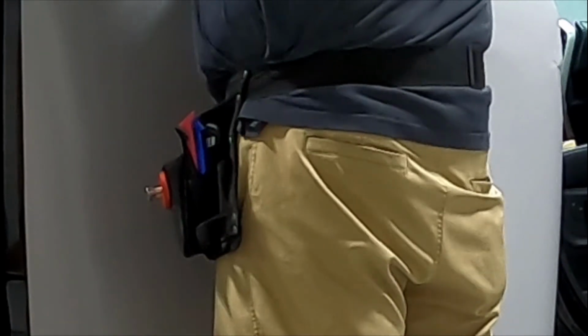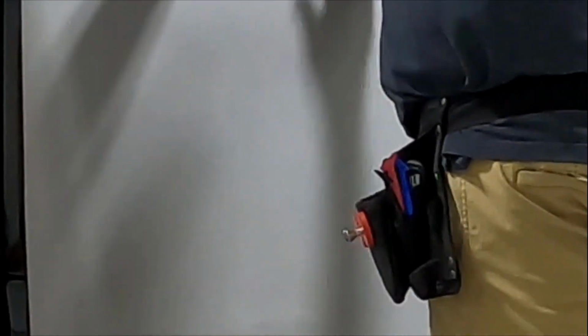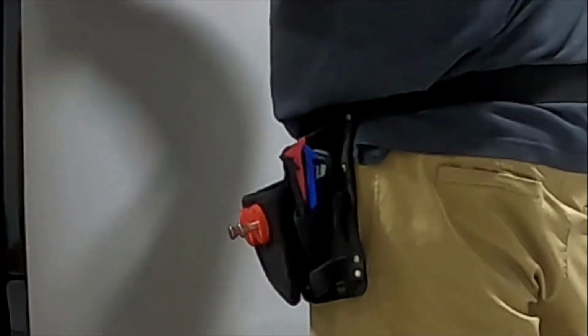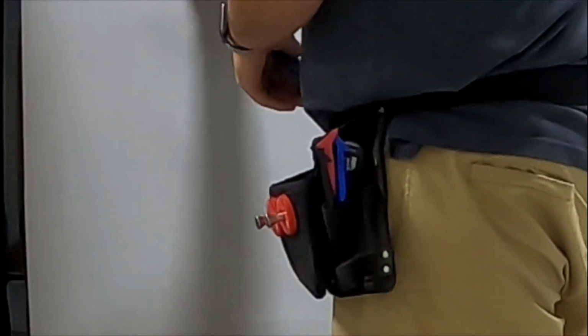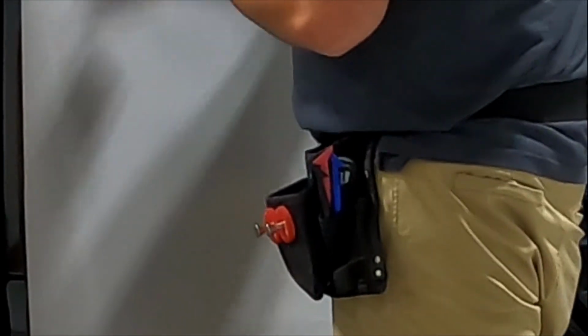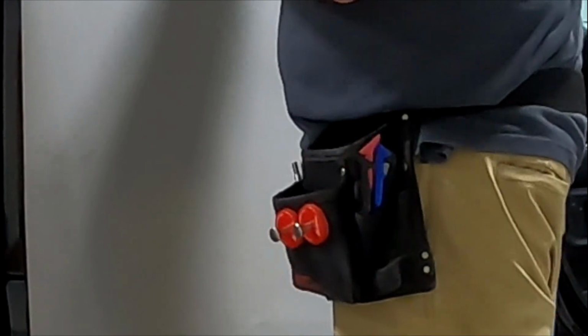First I'm going to bring this up. That actually looks alright how it is. I'm going to come up to this body line here. As you can see, I'm not really focused on wrapping into the window trim super far right now. I'm just getting to that body line and all the way around. I take my glove around, set that line real quick, go to the edge here, set that pillar, and make sure I've got nice even tension all the way across. I'm not pulling super hard, I'm not stretching a ton.